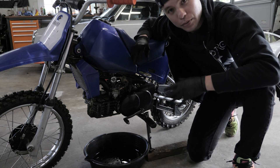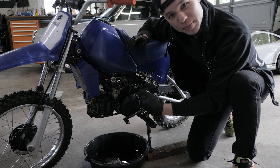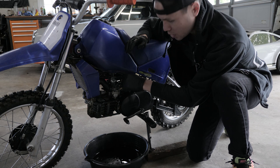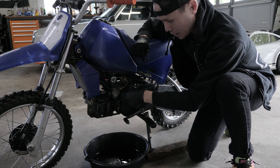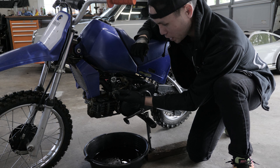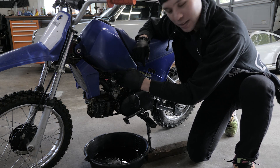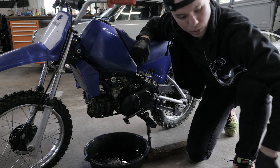Once you're ready to rock, the first step is to get the gasoline out of the carb. You can do that by first making sure that the petcock is turned off — that just stops the flow from the gas tank into the carb, goes through this little guy. Then you've got a screw right here at the bottom which will drain out the carburetor bowl. So you're cutting it off up at the tank, and then just draining out whatever's left into wherever you want.